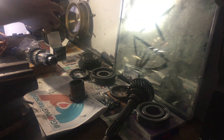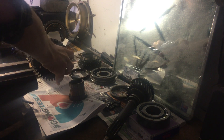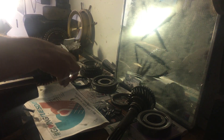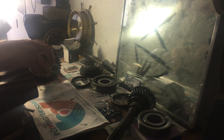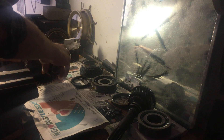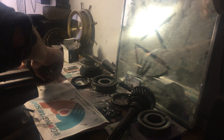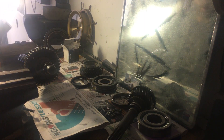First thing, you've got to make sure you have some assembly lube. We're lubing up some of the parts here as we're putting the new bearings on. Got to make sure that this ball on the main shaft is there as you're putting this piece in. There's a little locking indentation there that it wants to fit over. Just clicks right into place.